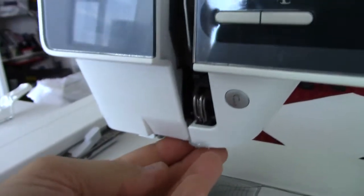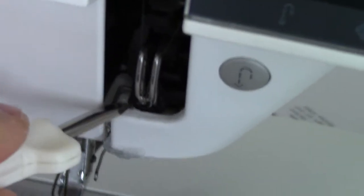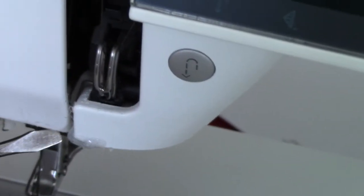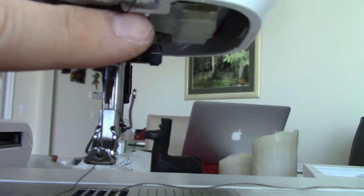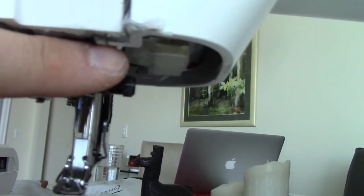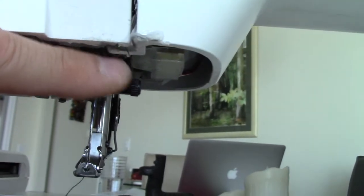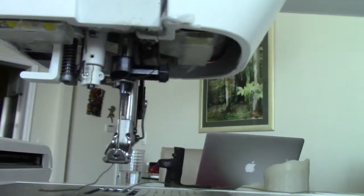The second part is much more interesting. There's a thread guide here — a little thread guide which goes underneath — that theoretically makes the thread run along a metal bit and not hook the plastic. But what I found is the thread would run and touch a little bit of plastic, which was getting a groove in it. So I got a piece of wire and, not very elegantly, I've just glued a piece of wire in place so that the wire does not touch the underside of the plastic where it was getting rough.